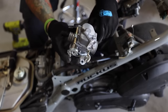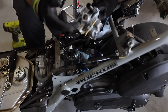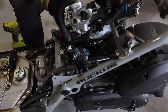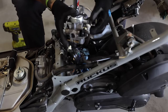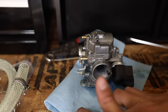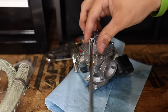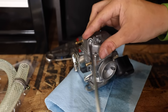Start with the throttle cable and get that out of the way. Remove the electrical, the coolant lines, and the gas line, which I currently have pinched off — so just a little bit of fuel leaking out of the carburetor itself. Over here on the workbench, we are still draining gasoline. You can loosen this screw here, which will allow the gas to come out of the float bowl. It's going to evaporate, so it doesn't really matter. I'll just snug that up — should have really done that from the get-go.